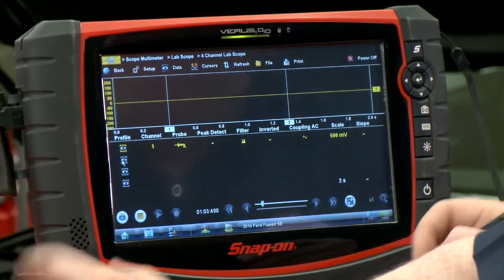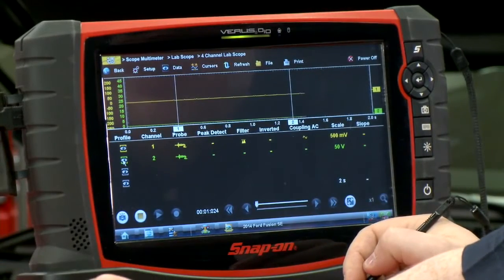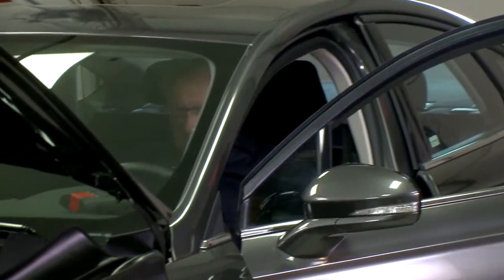I also need to know what cylinder is number 1 so I can check my firing order. So I'll turn on my channel 2 here. I have that plugged in on coil number 1, and that's going to act as my trigger to show me my pattern. All right, so I'm going to have Jimmy crank it over here in a second.